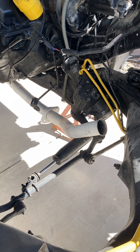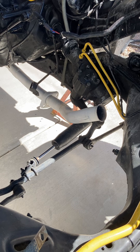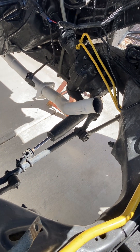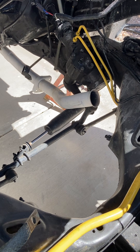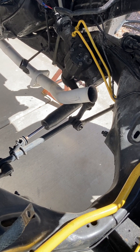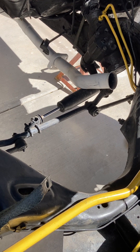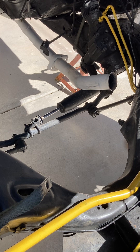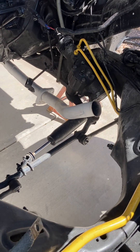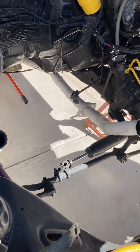Years ago we put in a new steering box with a quick ratio — I think it's 14 to 1 instead of the stock 21 to 1, so when you turn the steering wheel it has a faster response. I also installed an off-road steering stabilizer from a truck and welded a bracket onto the frame. It really helps with wheel wobble in off-road areas.